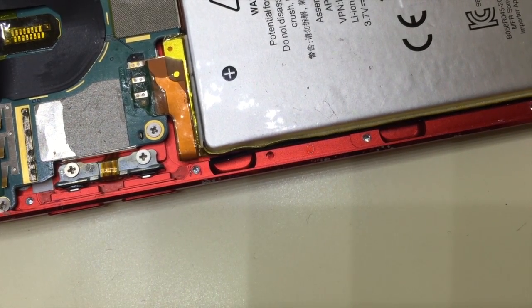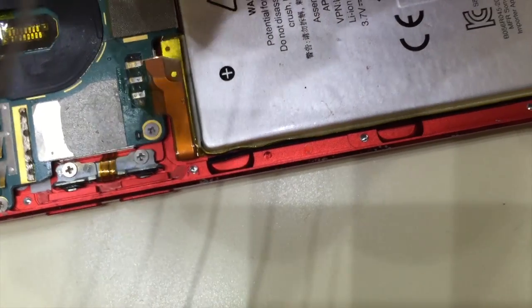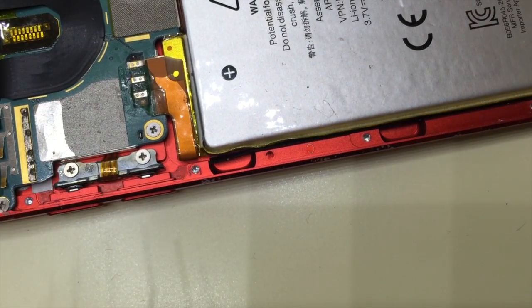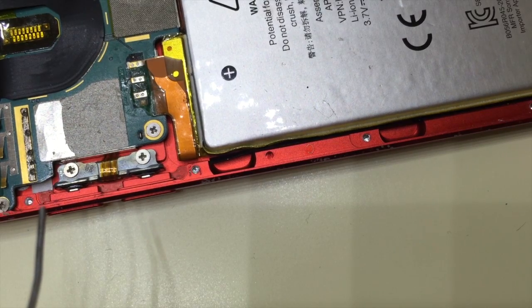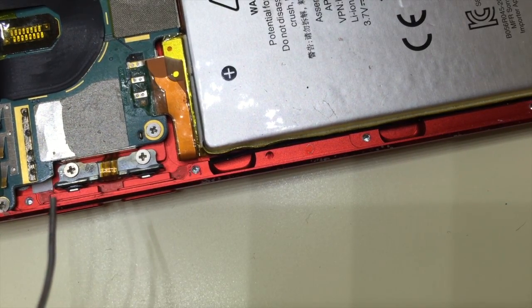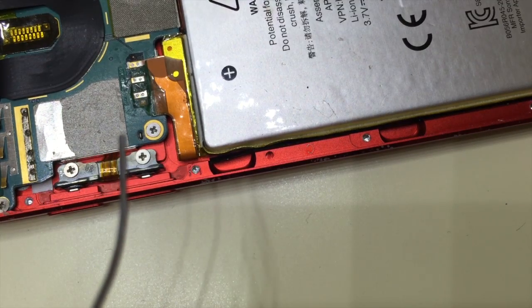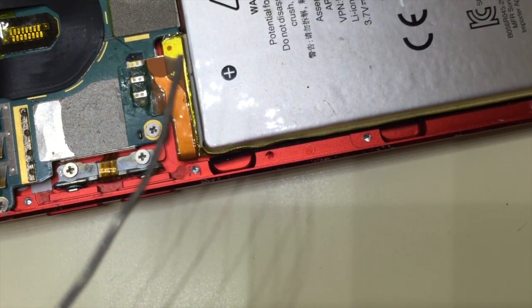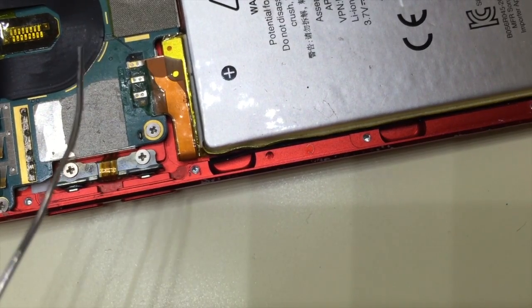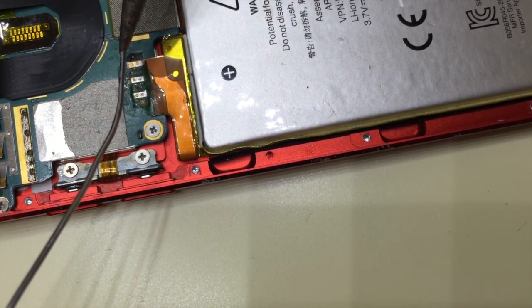Also, before I started all this, I took a good look at the connector. That's the power connector or data connector on this iPod. You might think it's the battery, but when you're diagnosing a problem, you have to start from the power. It would not power on, so that was the main symptom. You have to determine whether the connector is bad or the wire that you're using to power it up is bad. So first I used a different wire to make sure it was correct, and then used that same wire to power something else on and make sure that was all correct. You could also have a bad connector at the end of the iPod, so I took a magnifying glass and looked at that, and it looked okay. So I'm fairly confident that connector is fine, but we'll know soon.